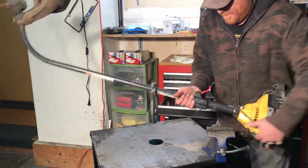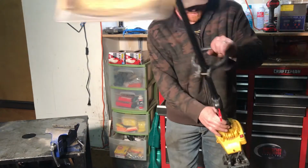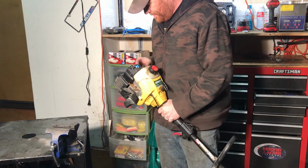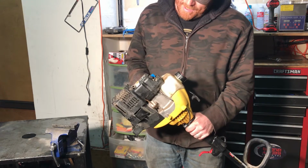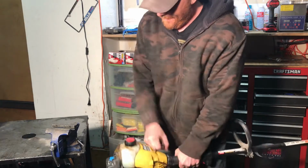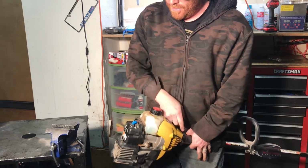Alright. This one should start right up. We'll make sure. Put it on full choke. Prime it a bunch of times. I think it's like 10. It'll kind of start. Put it on half choke.